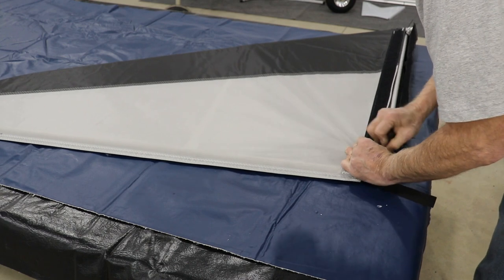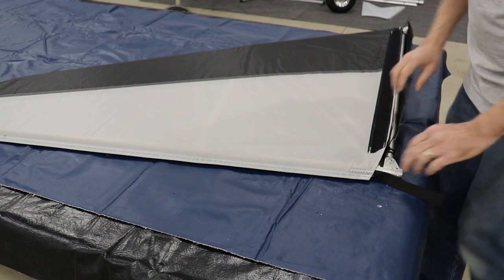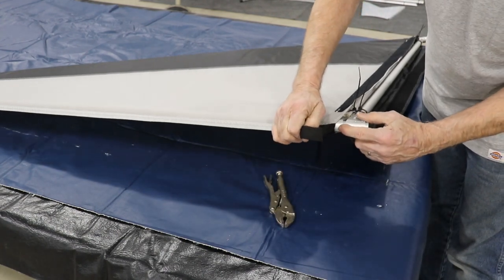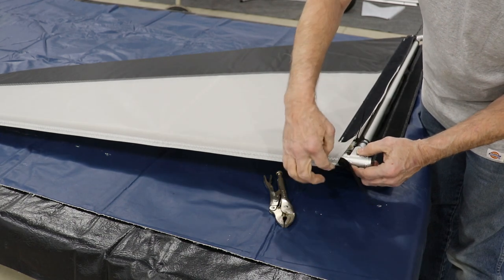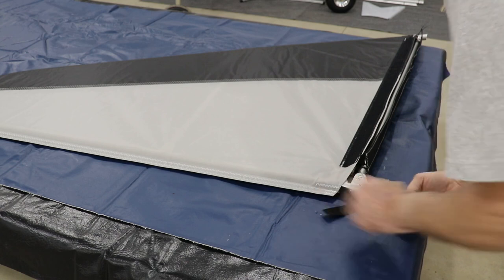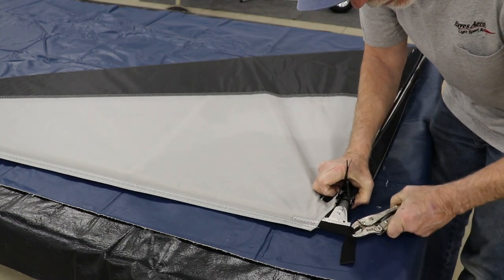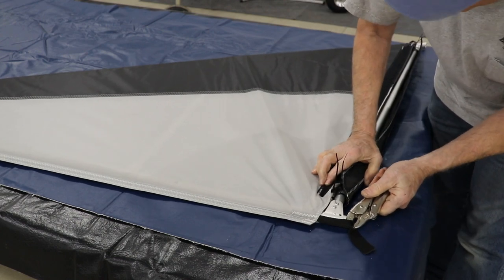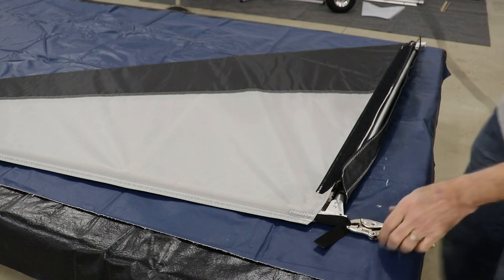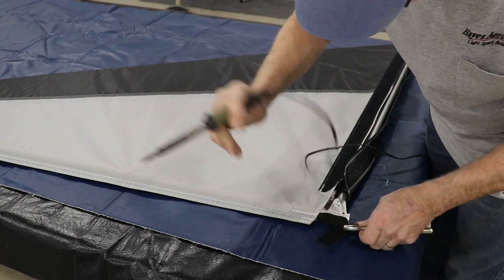Now we're going to take a look at the back tube. To get them sort of snugged up, there's a 3/16ths hole just off the bottom of the vertical stabilizer that we're going to want to burn a hole through — through this strap on the velcro on the skin — to hold the skin in place. A good way to get a hold of that is to get on there with some vise grips. You can kind of rock that around, and as you're rocking it, it's pulling that skin down pretty tight. It might be easier if you had some help doing this. We're going to burn a hole right through that strap when we have it held tight.